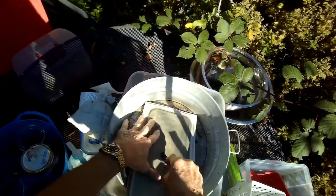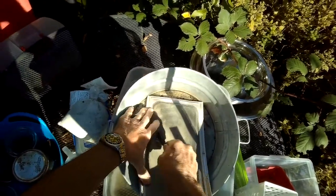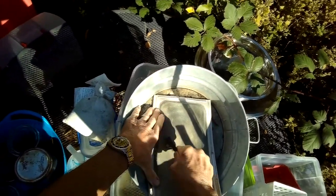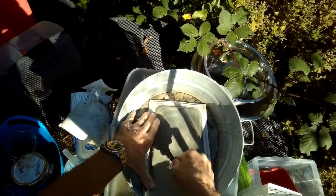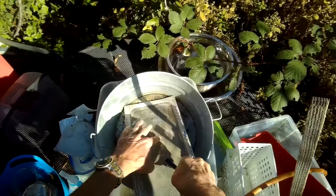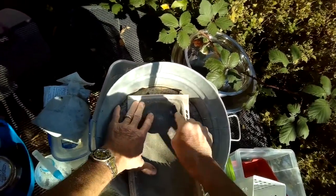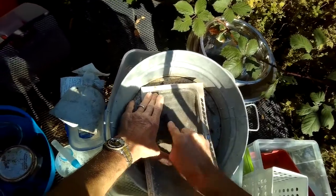And it isn't like the owner wasn't removing the lint, they were, but the dryer sheets had just built up more and more of the wax residue over time, to a point where at least 60% of it was occluded, and that's enough to create too much heat and blow the thermal fuse.